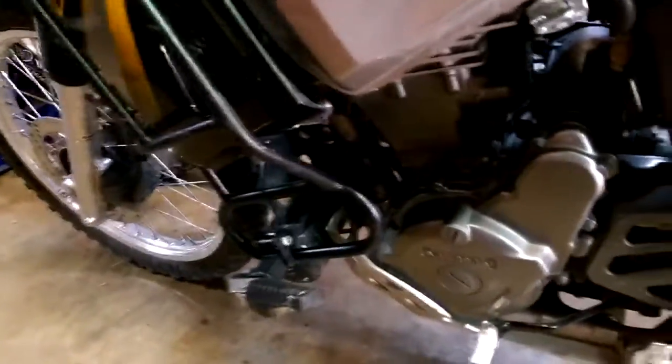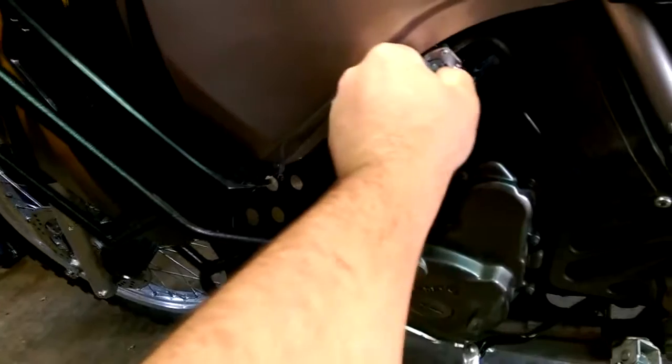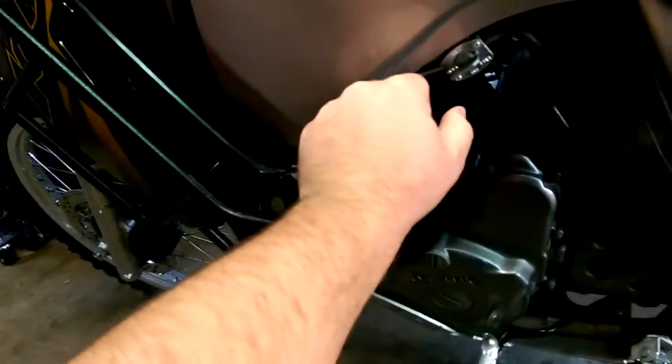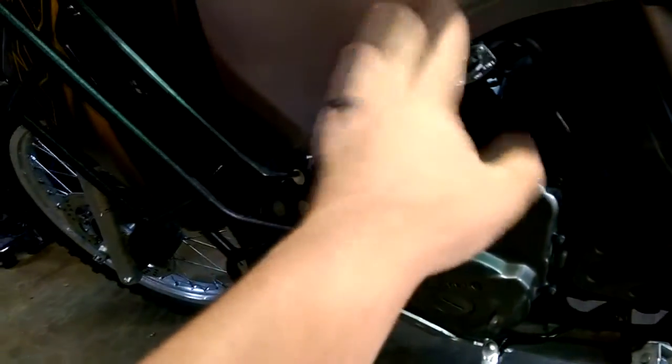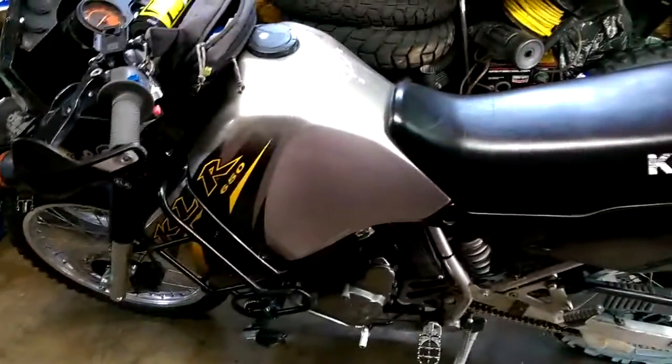Another thing I put on here is a manual fuel tap. You can now switch to your reserve — it's a much smaller reserve, some people say like a 10 to 12 mile reserve now compared to the stock one that's like 30 to 40 miles. You lose a lot of reserve but the gas is still in the tank, your reserve just kicks in a lot later. The reason I did this is because in a previous video my gas cap was hissing, and when I flipped it open it literally spewed gas like 10 feet above me. This fixed that and I haven't had the problem since.